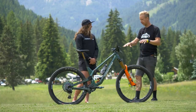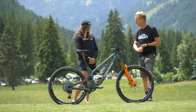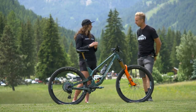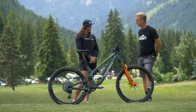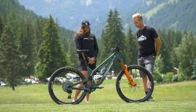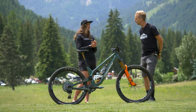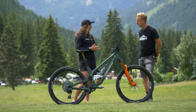How do you like your suspension to feel? Caro likes it very soft at the beginning, then getting more support towards the end of the travel. They're riding two volume spacers and around 87 psi. They tried between a 450 coil spring and the 475, and chose the 450 — but still figuring it out, as they've only had the bike for a week.